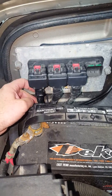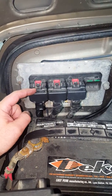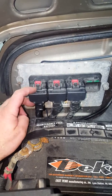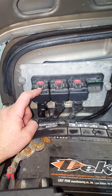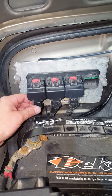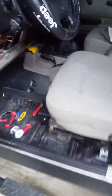What I found in this harness, and there's only one, is a blue with an orange stripe, and I believe I went ahead and set the cruise for 8,000 pulses per mile, just like it showed for the white with orange on the data sheet. I went out and test drove it. It does set and it seems fine. I do want to make some fine adjustments so it doesn't pull and set too fast or fluctuate going down the highway, but that's part of the installer's job on these things. But blue with orange stripe in there, I found it, tested it with my standard Snap-on test light that shows ground or positive pulse with a green and red light.